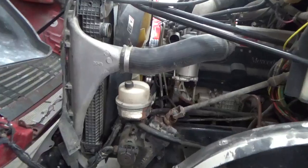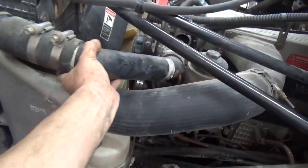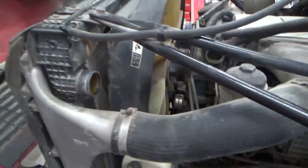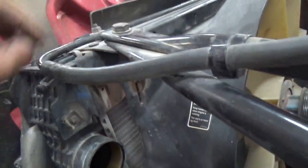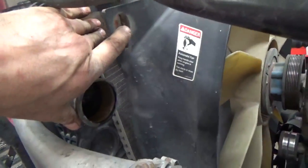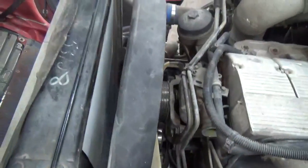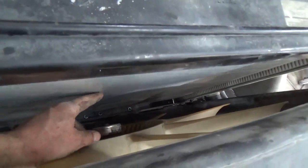We're on the driver's side of the engine. What we're going to take off first over here is this cooling hose — it goes over to the top of the water pump and up to the radiator. Once we've got that out of the way, we've got the other bolts out here on the corner of that fan shroud. To protect the radiator — because that's an expensive radiator — I take a piece of sheet metal and put that in there, because the snout of that fan is real close to it. There's not a lot of room in there.